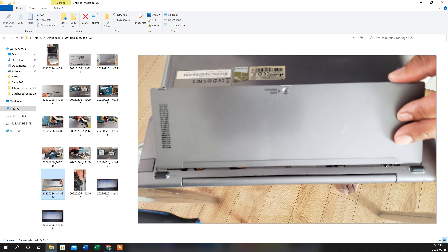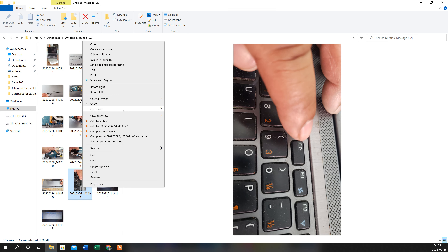For the back plate, note that there are three fasteners attached to it. Make sure there are corresponding holes aligned, then insert the plate from the top end — which is the bottom end of the laptop in this orientation. Once you align the three fasteners, slide it forward and it will tuck itself in tightly.